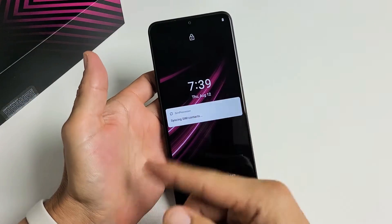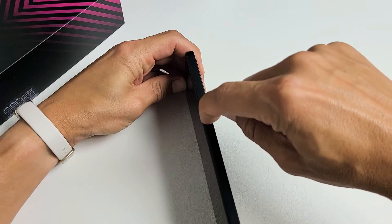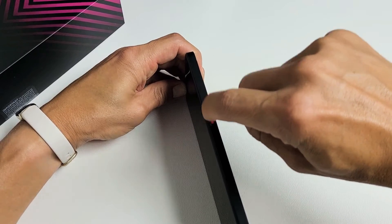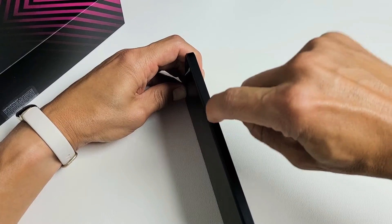Step number two. Let's pretend I'm still stuck in a boot loop. You see the power button here — what I want you to do is spam it. Spam it, meaning press in and out quickly. Sometimes if your power button is stuck, jammed, or loose, it can cause a constant rebooting issue as well. So keep spamming it.